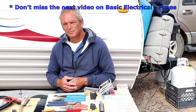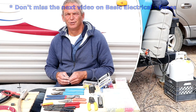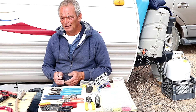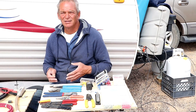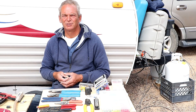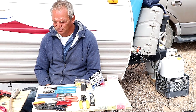That's where fusing comes in, and we're going to talk about fusing next. Fusing protects your wire — not exactly your appliance — it protects the wire from burning up, and your life. If you start having resistance, then heat, then more resistance, then more heat, eventually your fuse is going to pop because there's just too much resistance. It's taking too much power to push the electricity through the line. So always a little better to go slightly too big a gauge, better quality wiring, and better quality connectors.